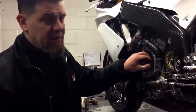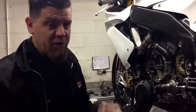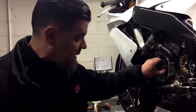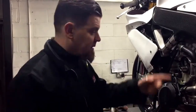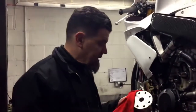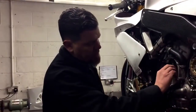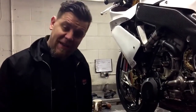It definitely wasn't tight enough, so it's worth checking. From now on in our services on bikes, I think as soon as we've got some confirmation — up to about 2012 or so — we're going to check them anyway. Pull the cover off — there's no gasket on it, it's usually just a little bit of case sealant. Pop the flywheel off and have a look behind — this is the nut here that we're talking about. When it goes back in: 100 Newton meters with Loctite. Any questions, give us a call, email us at service@apriliaperformance.co.uk or via our website www.apriliaperformance.co.uk. Take care and we'll see you soon.